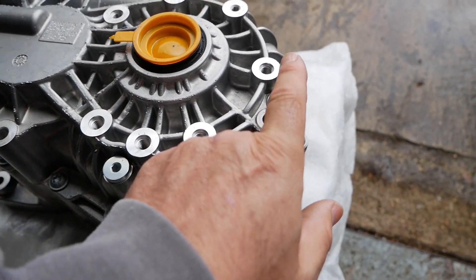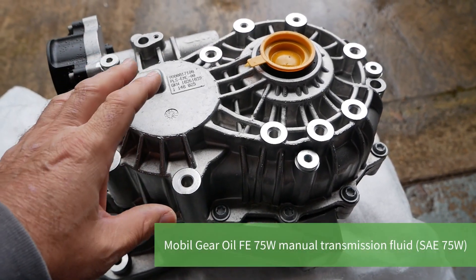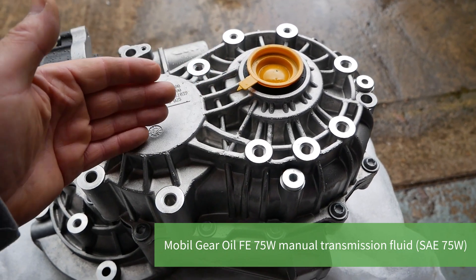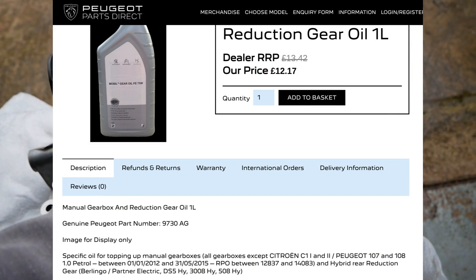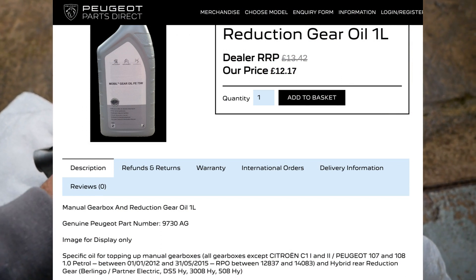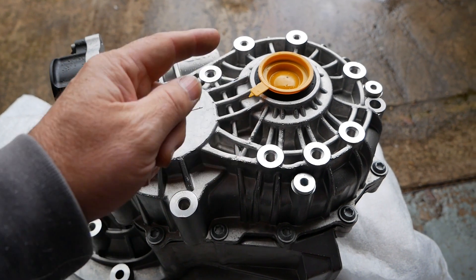When this is mounted in the vehicle it's very difficult to see — this will be facing the ground. So: fill plug, drain plug. As for the oil, I'm not entirely sure — I'll look it up and put it on screen — because the manufacturers don't state what oil to use since they think you'll never need to change it. But it'll be the same as all the others, just a gear oil. I wouldn't put ATF oil like Nissan's do, because that seems to be not quite up to the job.